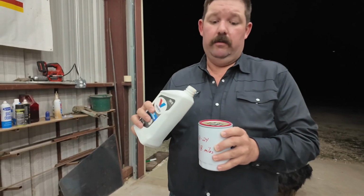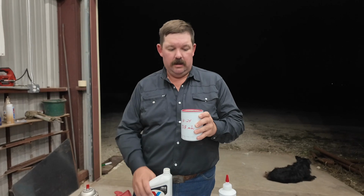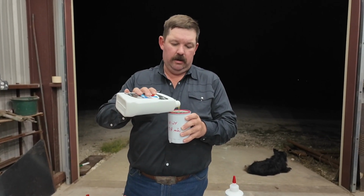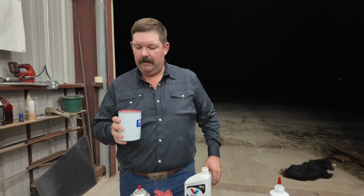Do not over tighten your plug when you put it in. You need to get it hand tight and then maybe a quarter or half a turn. You're not trying to put 400 foot-pounds of torque on that thing. You just want to get it tight so that it's not going to back off on you, and then it's good. Like the words of my friend Derek, you don't need two Ugga-Duggas on it, not even a half, maybe a Ugg or something.